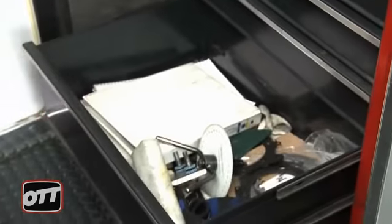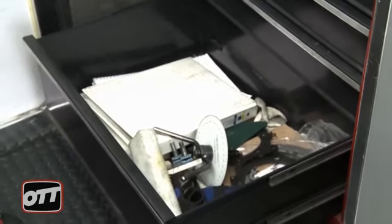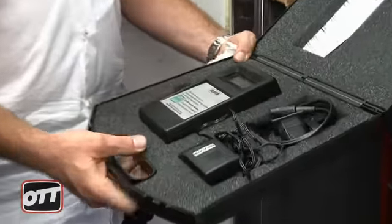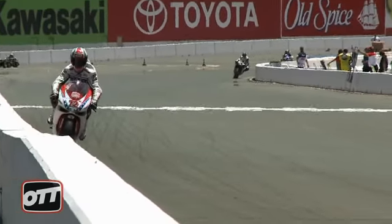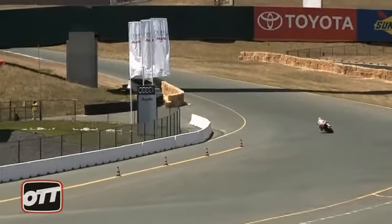And then in the bottom drawer, I've got some spare gaskets, a manual, some junk. Now, what's this? This actually belongs in the bottom drawer. It's a good thing we were here then. It's used to set the belt tension. It actually measures how fast the belt vibrates and gives me a reading. It's supposed to be 75 hertz that the belt vibrates at. We're talking about the cam timing belt? Yeah. Whoa, 75 hertz. That's a super secret data number for you to take home. You can look that up in your manual or your Funk & Wagnalls.